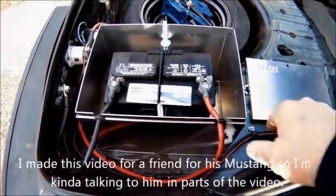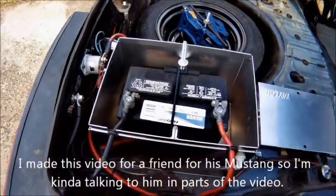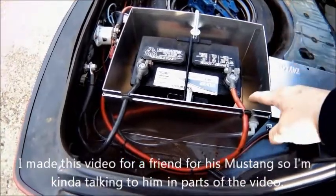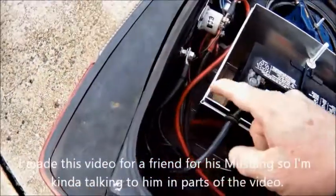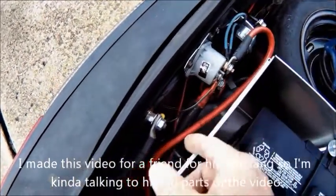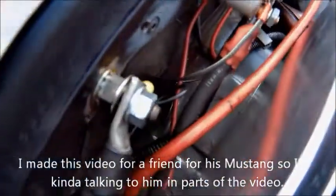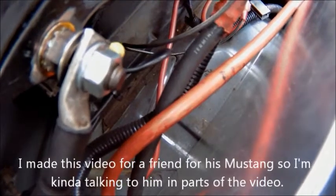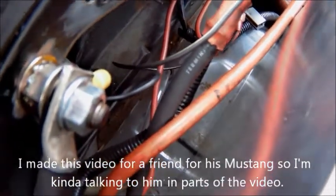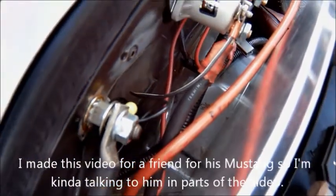Here's my battery box I have in the back of my car — I have a Taylor battery box. I don't know if your car is carbureted or EFI, but it really won't make a difference for what we're doing. Here's my battery cable, my positive coming off the battery and going to the solenoid. And then coming off of the solenoid is the starter cable right there — this cable right here with the red shrink wrap on there. This is the same setup as what you're going to have in your engine compartment. The only difference is now the starter solenoid is in the back of the car.